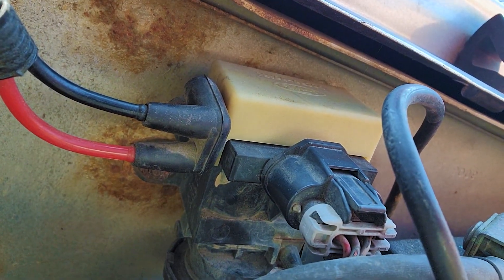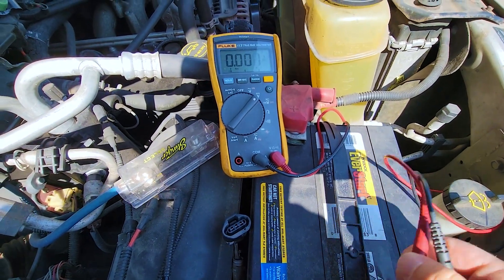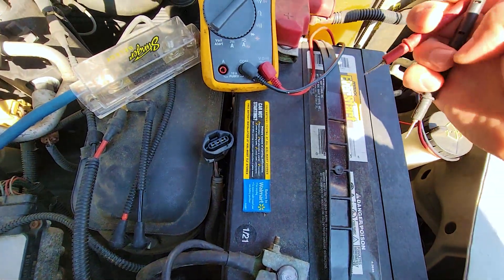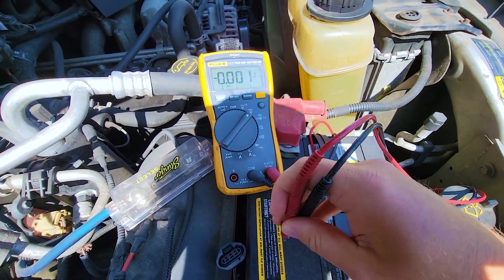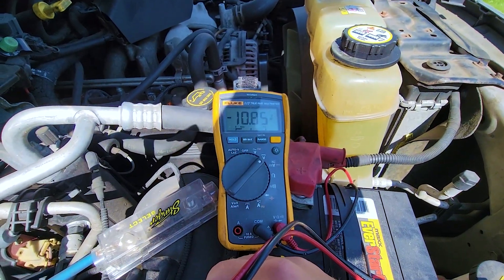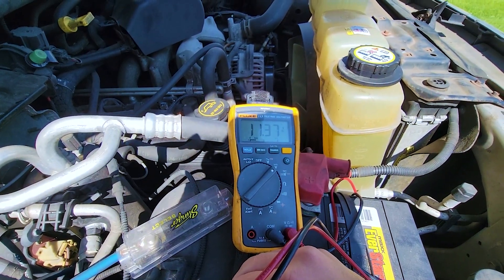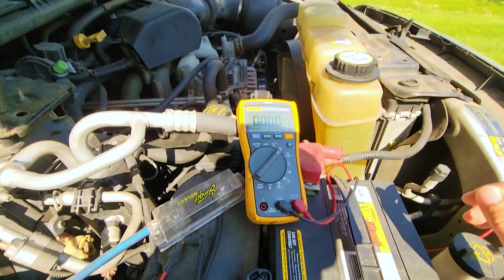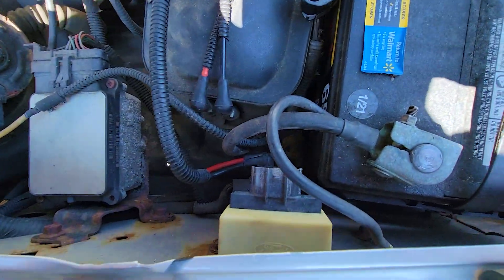You need to pull that connector out and make sure it is getting powered. Here we are with the meter on, set to DC — that's V with a straight line. This is the connector that goes into that vacuum actuator. Ignition is on, four-wheel drive is engaged, and you can see we have power. That power goes to this vacuum solenoid, which will send vacuum appropriately to the front two wheels to engage the four-wheel drive.